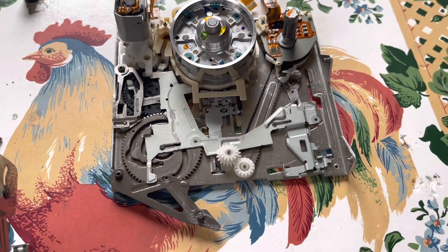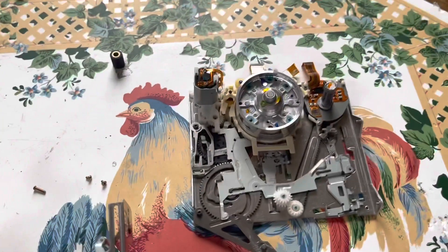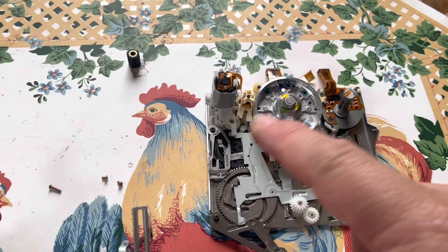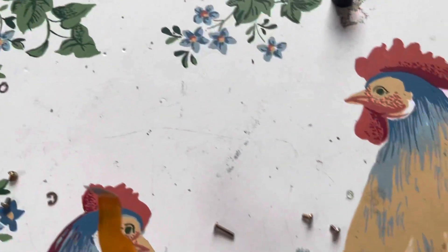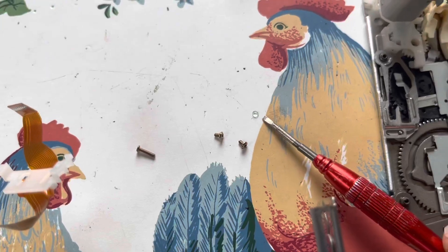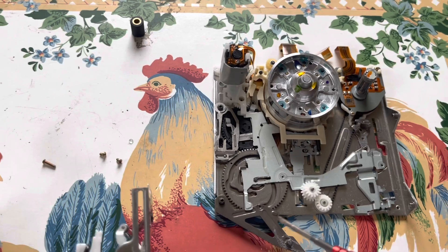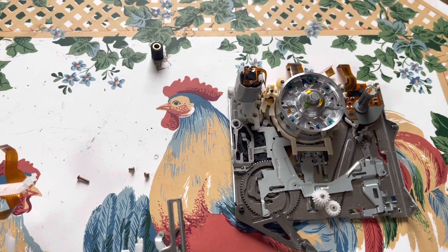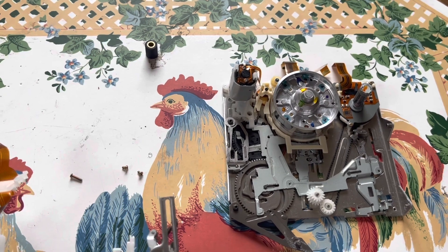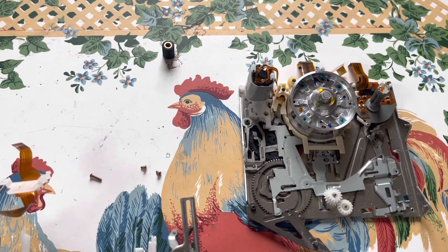Here is the transport side. To remove one of these and tear it down, there are two screws on the side right there. There's actually a C-clip, and you also have to remove this plastic washer, which holds that pendulum gear, and you can slide it out. I had to take it apart that way because it was jammed upwards, and there was no way to get it into position and take it apart properly. But either way, I got it apart without breaking anything else.